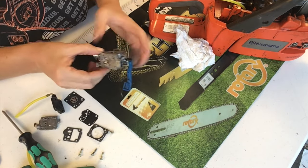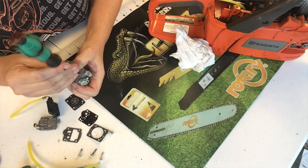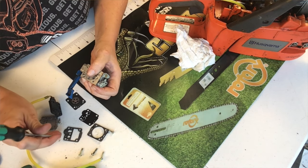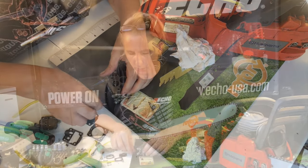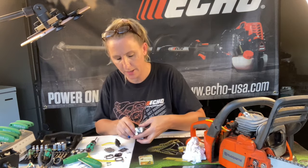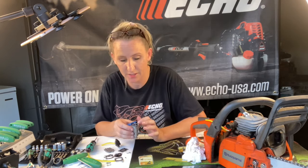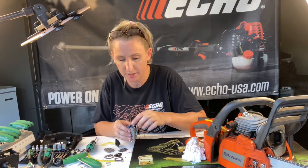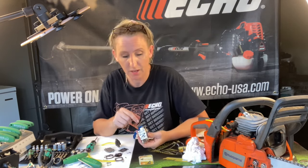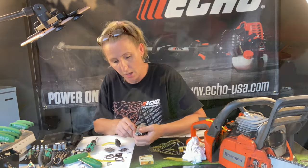Those are the pieces to the carburetor kit — we also have the needle, the little needle lever, and the spring. When you go to put it back in, you'll want to clean it. I put mine in the ultrasonic cleaner, or you can spray it out with carburetor cleaner. This carburetor does have splined high and low jets that require a special tool — a lot of people don't have it but you can find them online, I'll put a link in the description. The spline tool fits all the Poulan units as well, so it comes in really handy for Husqvarnas, trimmers, chainsaws, and Poulan and Craftsman stuff.